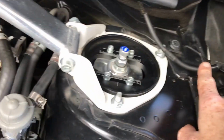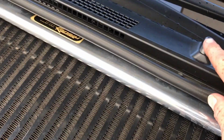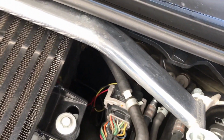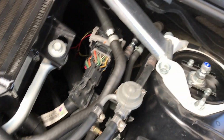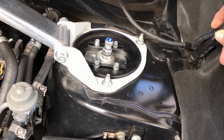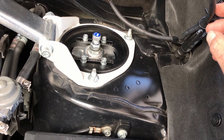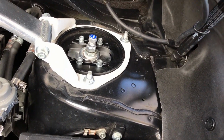Now the other side of this pipe is going into my windscreen wiper jets, but the valve that I've installed, which is now hooked up to my turbo via a vacuum line, when the turbo hits 10 psi, it actually pushes air through that vacuum line. That activates a solenoid, which clicks the valve over to start pumping water into this line.